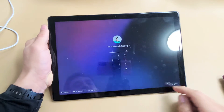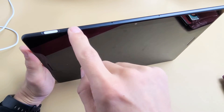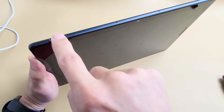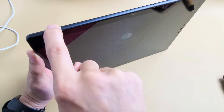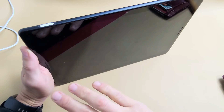This one is obviously fixed, but we're going to pretend we have a black screen. So first thing I want you to do is go ahead and restart it using only the power button. Let's pretend the screen here is totally black. Go to your power button and press and hold for 10 seconds — 1, 2, 3, 4, 5, 6, 7, 8, 9, 10. Okay, so now it's totally off.